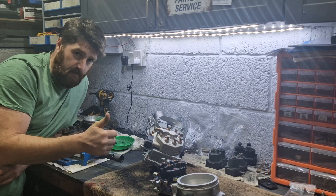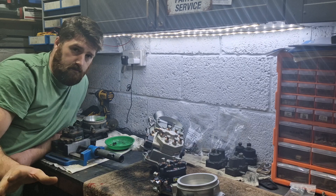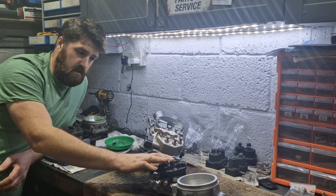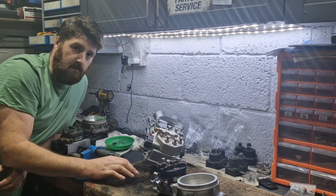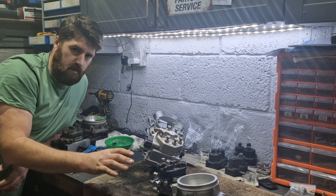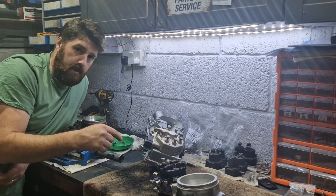The main point of this is firstly to see what the airplate's doing, and secondly to confirm that this is a stock 16 valve and mine has obviously got the Porsche air meter on it with the adjusted 16 valve units. My 16 valve units flow at 180cc a minute of fuel at maximum plate lift, versus stock which does about 140cc at full plate lift — that's 40cc more fuel, which is a hell of a lot. But is all that fuel going into the engine?